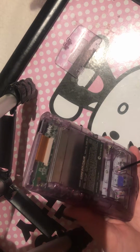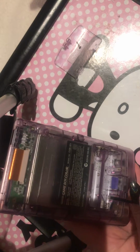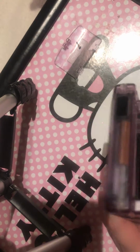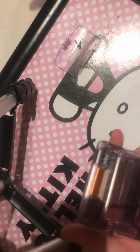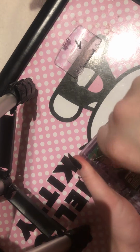And all my screwdrivers are, as you can see, magnetic, because I agree with taking each screw out like this. There are some people that you see that seem to undo all the screws and then bang them on their console on a hard surface to basically get all their screws out. I don't run with this method, mainly because you run the risk of breaking something inside.